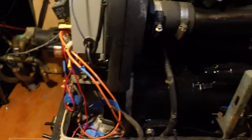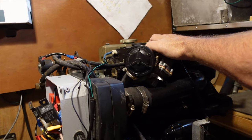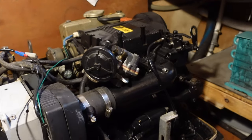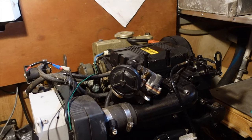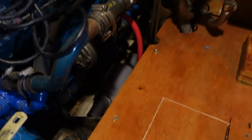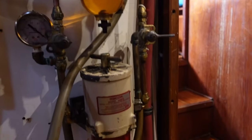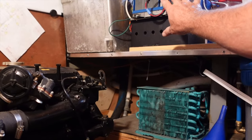I'm just trying to configure where all these components are going to go. The generator did need a little bit of love. As you know, it had the issue where someone had tampered with the injectors and left them loose, which was bleeding fuel into our oil and causing the oil level to rise and causing all sorts of problems. That's why our previous owners gave up on this generator — due to someone's inexperience fixing the engine correctly. Lucky enough I was able to find what was wrong with it. It's only got a thousand hours on it. A few of the components that were missing: the water lock, exhaust line, fuel line, and fuel filter, which I've mounted over here — it's not plumbed up yet. Pretty much all we've got to do is get this inverter box mounted here.